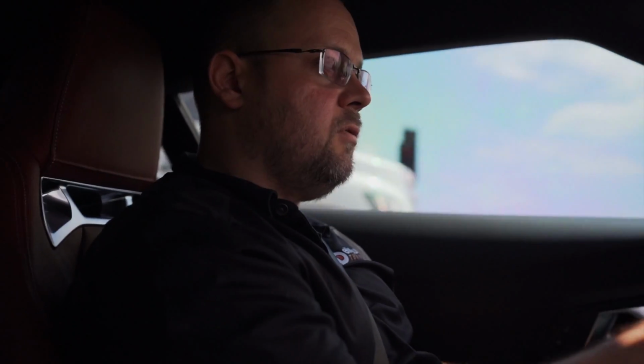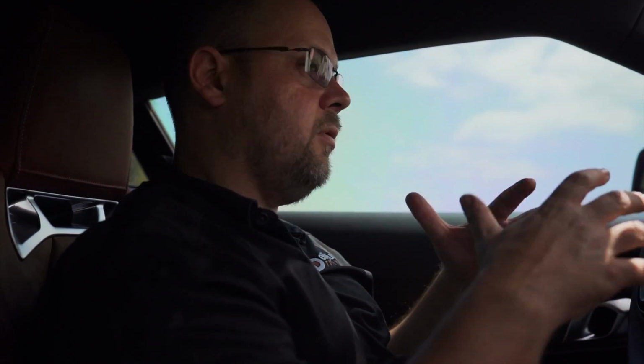And so you're going to be coming out, as you get more tunes, for example, like bigger turbos, or let's say an exhaust or something like that, and you guys have the capability to tune and add those? We can do certain things, we can't do everything. It's obviously just a module you plug into different parts of the car, into the map sensors, and we change the boost that the ECU thinks it's seeing. So if you put a different exhaust system on the car, we can have a different tune for that. If you do a different intake, we can do that. Different intercoolers, we can do that.